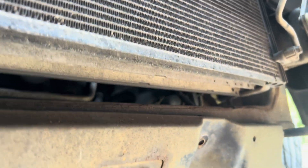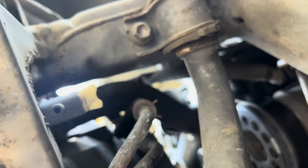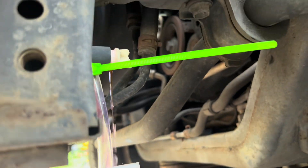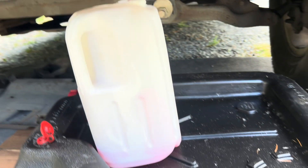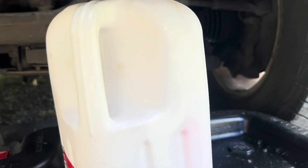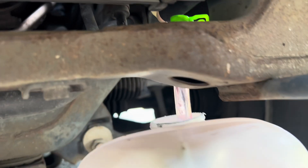There are four 12-millimeter bolts to remove the under-engine cover so you can get under the radiator and go to the stopcock in the corner. Here's the front of the car — there's the stopcock. Turn the stopcock, put a little tube at the end and zip-tie it, then drain. Since I'm low on coolant, the total capacity is around two gallons, but we'll see how much I have left.